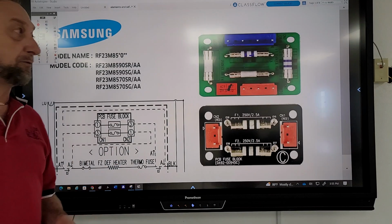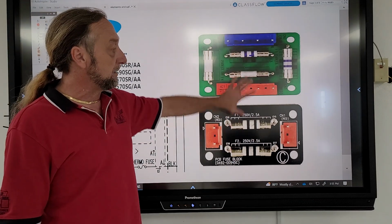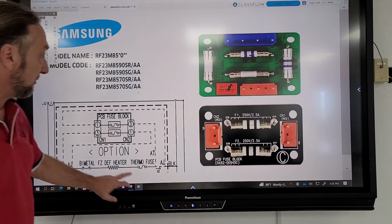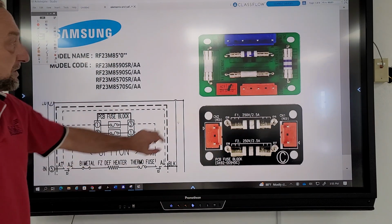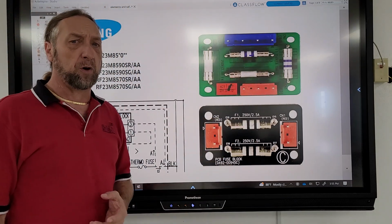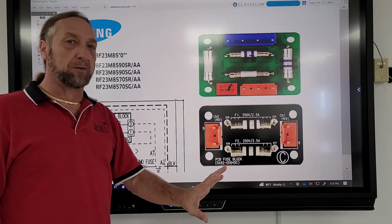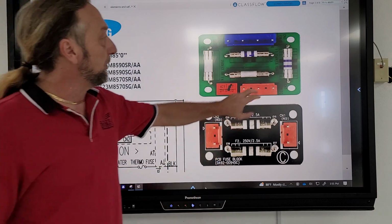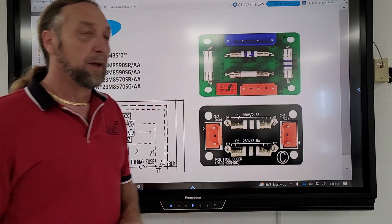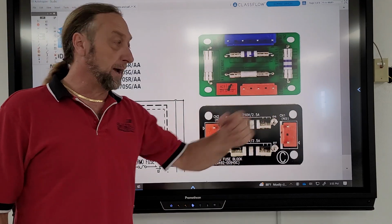this is the Samsung one that I've talked about. These aren't thermal fuses because they're located in the back. And the reason I have the two pictures is that this is a single defrost heater circuit, whereas there are four fuses here because this has two defrost heaters. This is one that has a defrost heater in the refrigerator evaporator and a defrost heater on the freezer evaporator. So two of these fuses, notice you got two with a stripe here, and then you have two white ones, so two go with one heater and the other two go with the other heater. Again, before and after the heater.